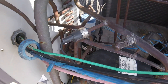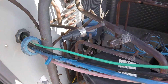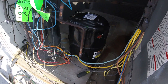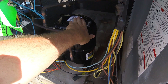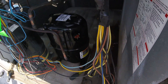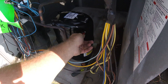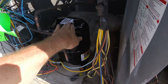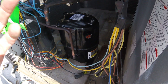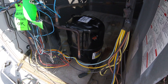Then I put it back over and zip-tied it up here so it pulls and holds the filter dryer up as I force the line in. After I get that to drop in, I can just solder it in. Now I'm just waiting for it to cool and I'll put the strap back on it. I also noticed — I got this compressor and it has the old kind of wiring, but it didn't come in the box with the plug.